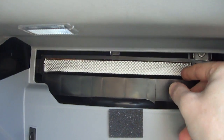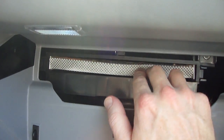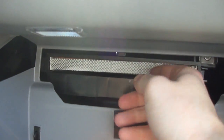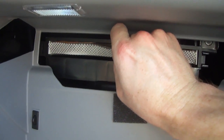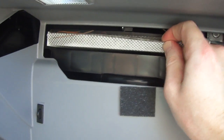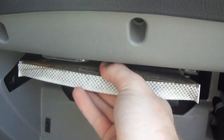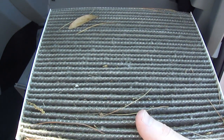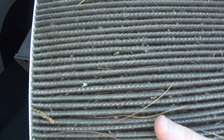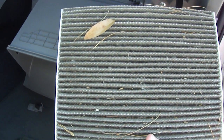As far as the air filter goes, there should be a small tab. It's paper, so you can work your fingers in between the pleats a little bit to get a hold of it and then pull it out. You don't want to distort the shape of the filter too much though, or it might not come out evenly. This is the first cabin air filter change I've performed — this car is about 10 months old. As you can see, it gets quite dirty, and this is what you're breathing in when you have the air on in your car. Pretty good idea to change that out.